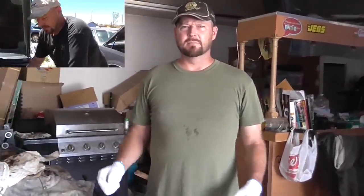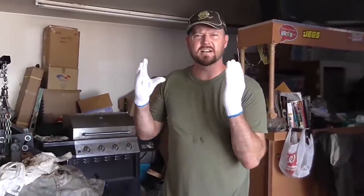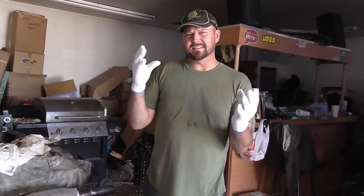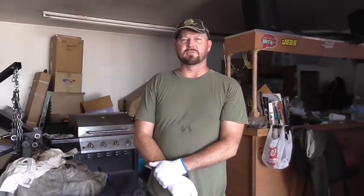This is Mad Matt from Budget Boosting. In one of our other videos we talked about intake modifications, but if you want the full benefit of an intake modification, you want to do the exhaust system along with it. Today we're going to talk about how to free up your exhaust system and make it more free-breathing, because you can have your intake breathing in real good, but if your exhaust system is not breathing out freely to match it, one thing is going to be better than the other. The engine needs to be as equal as possible — equal to breathe in, equal to breathe out — to get the maximum performance and fuel economy.